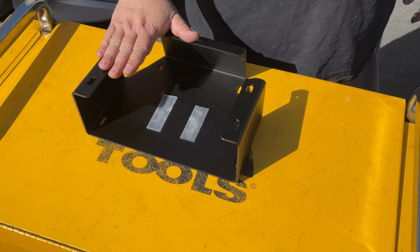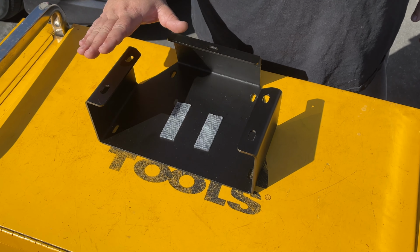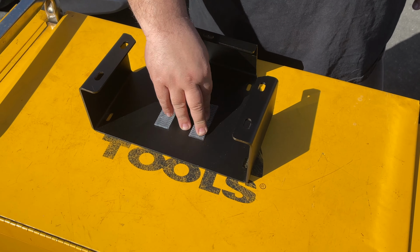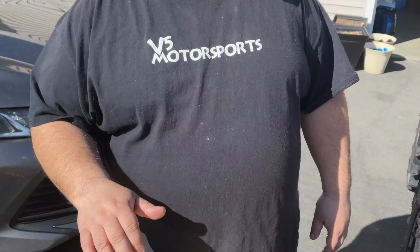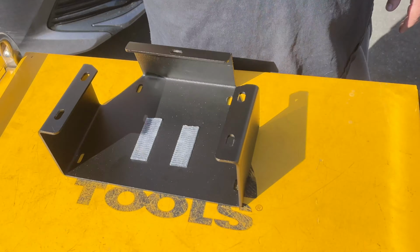This is a base portion that's going to house the Pelican case inside here. I already took the liberty of installing the pieces of 3M tape that they provide in the kit, which is pretty cool. Just make sure when you do this, it's always a good idea, 2 things that you want to do. 1, got to be hot, or at least warm. This way, at least the glue adheres to the metal. 2, alcohol pad. Scrub it down. Best way for it to stay on there, all right?